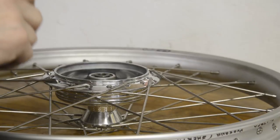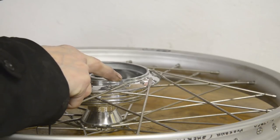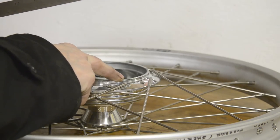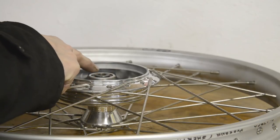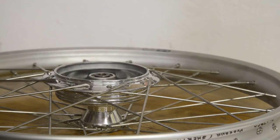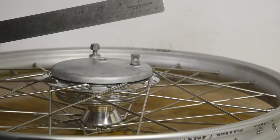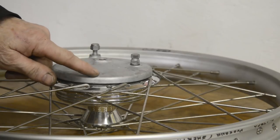Okay. Now at the edge we had an extra 1/2 inch. So if we add 1/2 inch to 3 13/16, 1/2 inch being 8/16, we get 4 5/16. And if we add 5/8 to it in the center, we get 4 7/16. Right? So when I put that on, I did the same, put a straight edge across, measured the edge. From the bottom to the edge is 4 1/16. And we've actually got 4 5/16 worth of space, so that is not going to touch the fork.